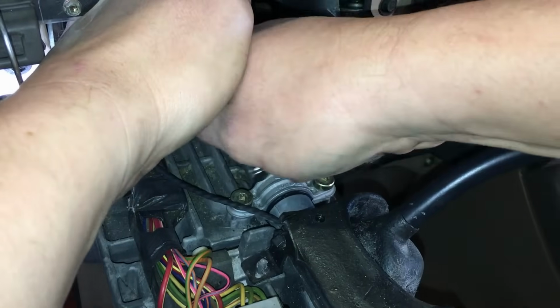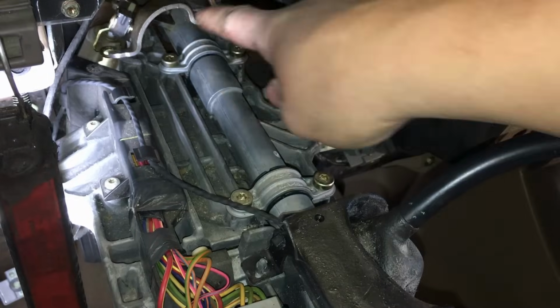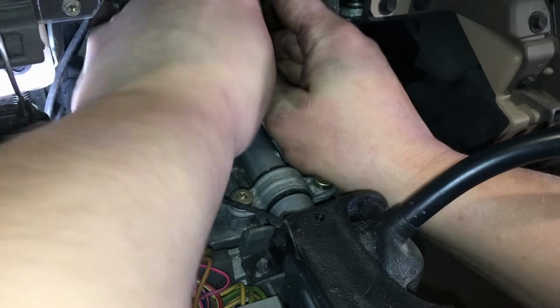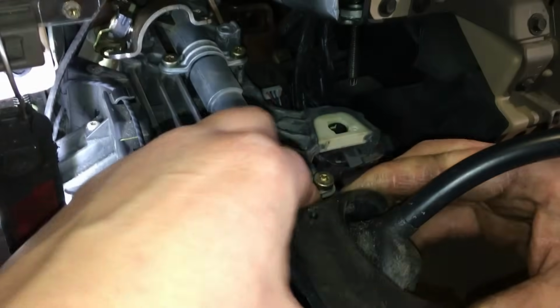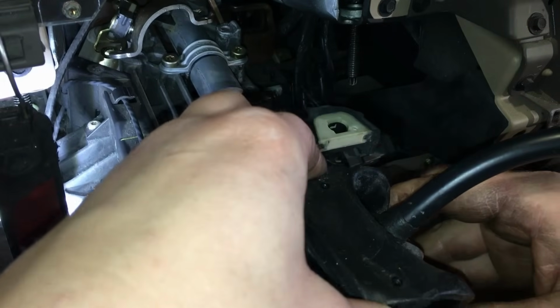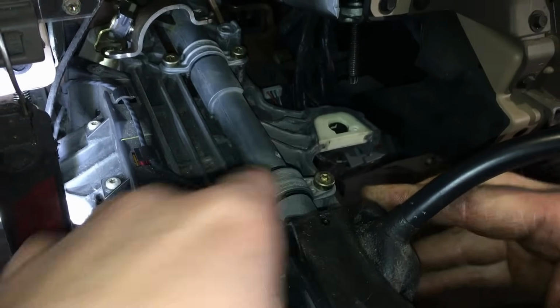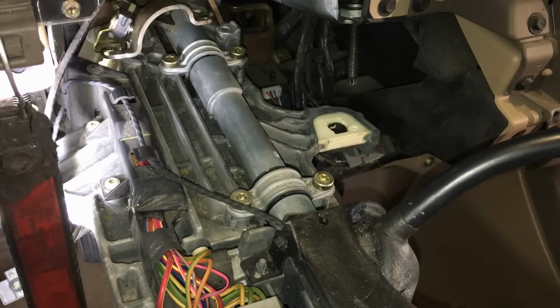Now once the shifter tube is laying flat in place and we tighten these straps, we can go after the brake shift interlock back there and get that secure. Alright, those are on. Let's go ahead and put this boot back on. Mine's a little cockeyed in here. It has 2 notches it slips into. There and there. Okay, these look good.